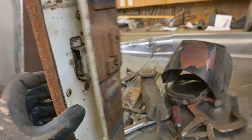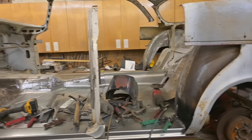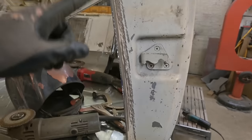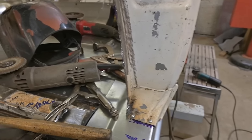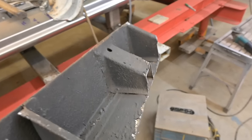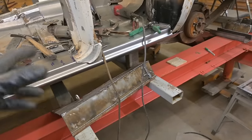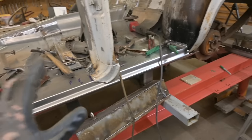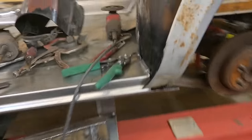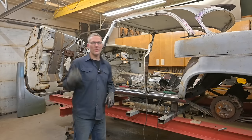Let's see if I can open it one-handed here — look at that! Success, guys. Now that we have the door lengthened, we can go ahead and form up these rear pieces and get that post solidified. We're also going to create a diagonal brace down from the post down to this body mount — this is really strong in here. We're going to tie the two together, in addition to reinforcing the underside. Once the rocker's out, we'll get the rocker in, no post, weld through, pick up that diagonal little gusset, and then bring the post in, weld the post in. It's got to be done from the inside out — otherwise you'd be working from this little tiny hole all the way down through there, which is technically impossible. So let me get this welded up and then we'll get started on this inner web.